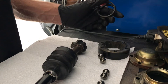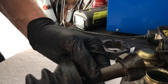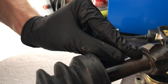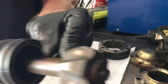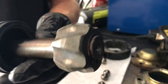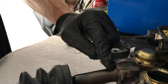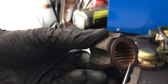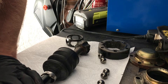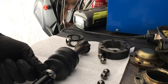As far as orientation of parts goes, there are a few things you want to pay attention to when you're taking it apart. The first thing is this centerpiece, this star. You'll see there's a raised lip on one side of it and it's flat on the other side. In newer, more modern designs it's flat on both sides and the only way to tell the sides apart is to look at the actual center splines — they're recessed on one side. I've also seen photographic evidence of them installed backwards from the factory, so I'm not sure it makes any difference at all, but in the interest of doing things exactly right it's something to pay attention to.